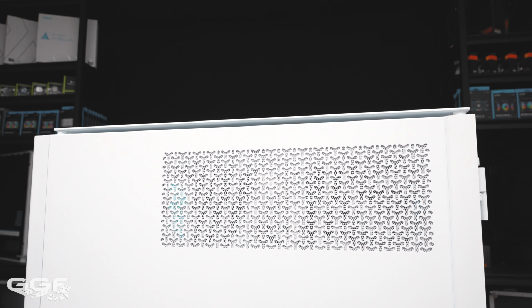Double shot cable grommets are all over the case. You'll find 6 directly next to the motherboard, 4 on the top ledge for EPS and other top motherboard I/O cables, 4 more on the front ledge of the motherboard tray, 1 under the motherboard for fans and front power reset cables, and a last grommet can be found on the PSU shroud for when using an ITX motherboard. I would say these grommets are some of the best I've tested. The outside rim is firm and really stays in place, while the middle is much softer.